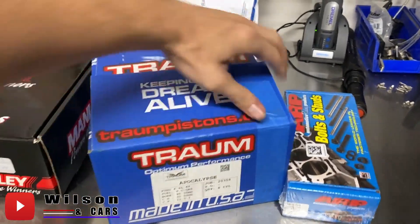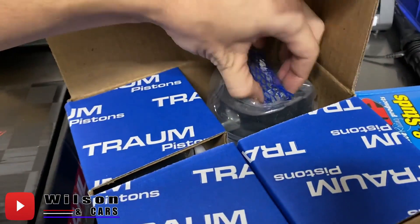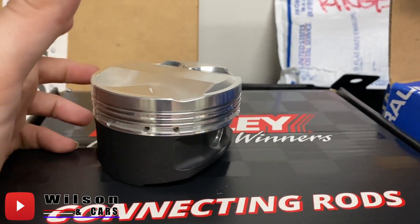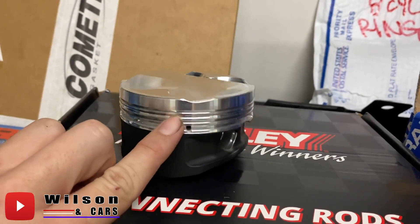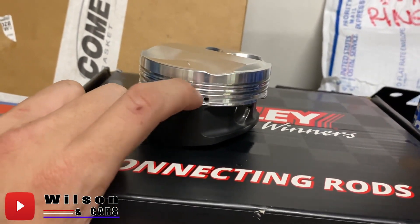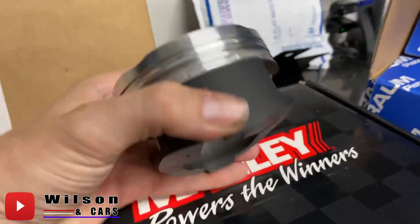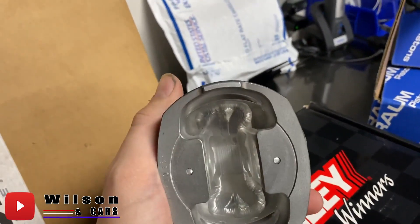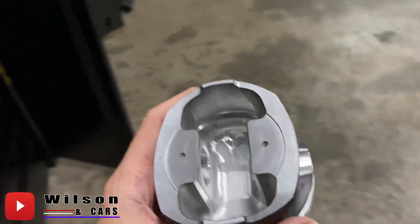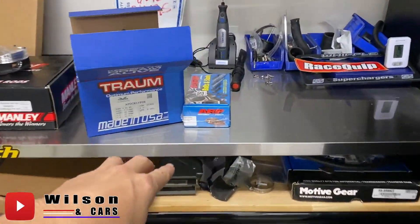Let's take a look at these pistons real quick. As you can tell, we've got a little bit of a dome going on. The top ring down is 290 thousandths. It is a 1.2 top ring, a 1.5 Napier second ring, with I believe a 3mm bottom oil ring — don't hold me to that, it could be 3.5 but I think it's 3. I opted for the moly side coating, which looks phenomenal. The piston looks really good and you can see on the bottom where they went in and milled it out for weight reduction and balancing. The piston pins themselves are 200 thousandths — good and beefy.